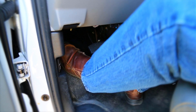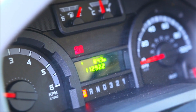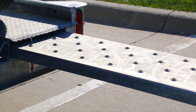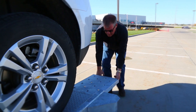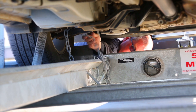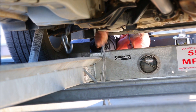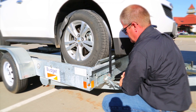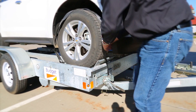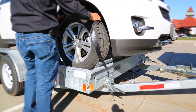Fully engage the parking brake on the Budget Rental Truck. Extend the ramps by pulling the release latch down and fully extending each ramp and lowering them to the ground. Unhook and release each safety chain, both front and back, underneath the towed vehicle. Remove the winch lock pins from the strap winches. Grasp the handle, squeeze the trigger, and push down to loosen each tire strap.